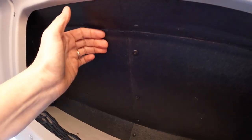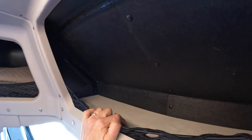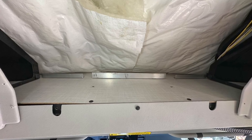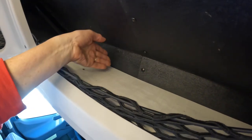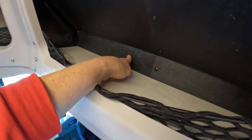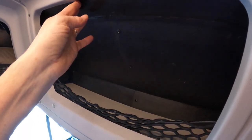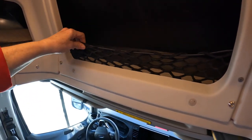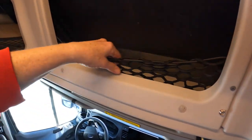The cubby angles straight up, then angles again near the top, so it was tricky to get everything to fit — a lot of test fitting. On the bottom, we put an aluminum angle adhered with VHB tape to give the bottom pieces something to attach to. To finish the look and keep things from falling out, we got a stretch net from Organized Obi. It's a little different from the ones nearby but long enough for the space.